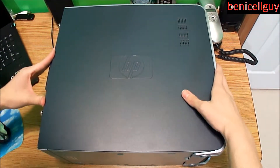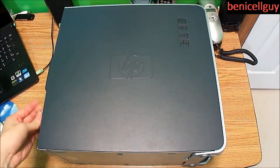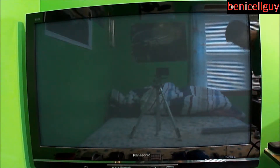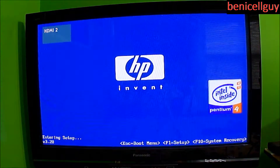All sticks are in, and now I'm just going to go through the process of putting back the side panel, rotating the screws to secure it back on — and that's it. The computer is hooked up to my TV which I'm using as the main monitor for the HP 8250N. I'm going to turn it on, plug the power cord in, and get into the BIOS first just to make sure the 4GB of RAM is recognized.